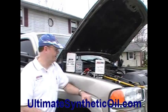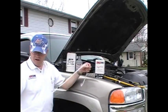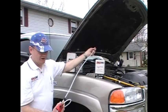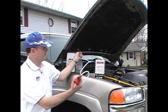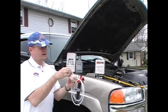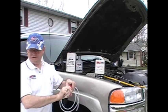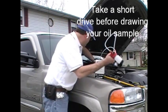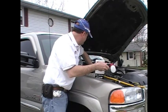Back to the main part of what we're doing here. We're going to use this oil sample analysis pump kit combined with our oil sampling container. What I've done is I've gone ahead and taken my dipstick, and I've marked out a piece of tubing here with a piece of plain electrical tape wrapped around it to indicate how long the dipstick needs to be. The tubing would be down at the bottom of your dipstick. Then you take your container that comes in your oil sampling analysis kit — this is the standard container size — and it screws onto the pump. Then you simply slide this down inside your dipstick tube, so that the electrical tape is there at the mark point.